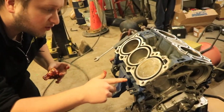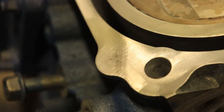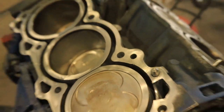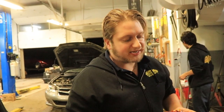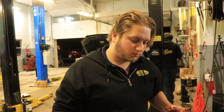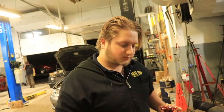It's hard to see, but if you look in here, where those imperfections, little black divots, that is called pitting. Now, pitting is new to me since I've never worked on engines before, but as Ari explained to me before, that's what happens when you have a blown head gasket and you run the car for a little bit. Coolant, oil, whatever gets in there, it heats up, contracts, and basically breaks stuff in there. The metal warps, and basically it just kind of digs out. So all the carbon and everything from the combustion. Yeah, everything just kind of gets destroyed up in there.